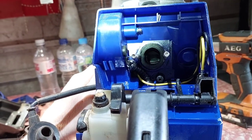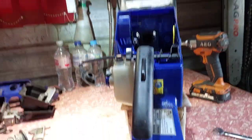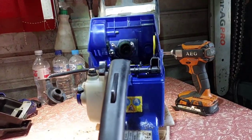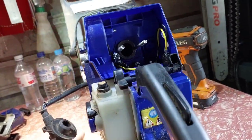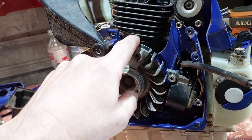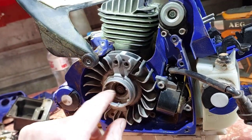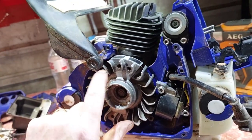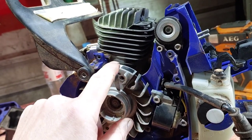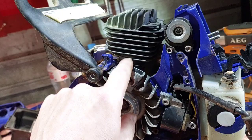Now, the exhaust was 102, so I don't really have to make the exhaust any higher — I'll just make it a bit wider. But I will get right into the transfers because I want the transfers to have more room, so there's more room to have more air and fuel stored in the sump so I can go bang. As you know, I like my Stihls — Stihls have massive transfers. They're low compression in the 70s and 80s, but they're holding all that air in the base of the sump.